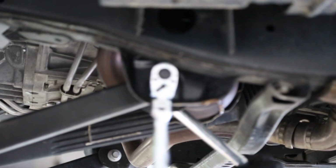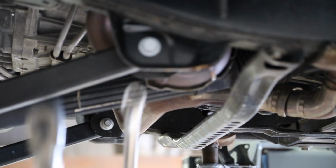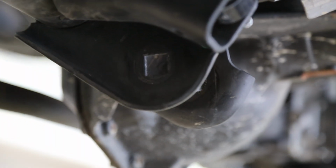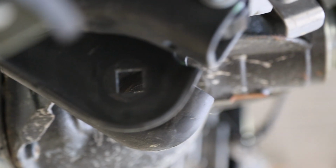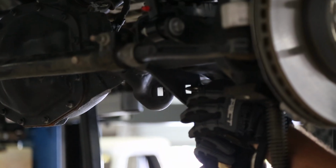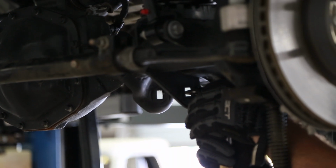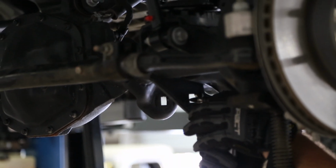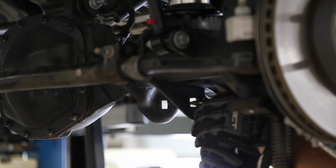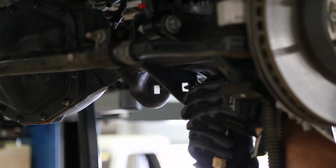For the caster correcting cam locks installation, I took the Jeep to San Diego Off-Road and Custom in Lakeside, California, as I knew that Mike had a lift, high-speed air power tools, and the right size tools to torque the connecting arms after grinding away the material necessary to make the correction to the caster setting, which had changed when the body and the frame were elevated further above the axle by the lift kit. A member of San Diego Jeep Club's board, Mike is an excellent mechanic and is highly recommended by just about everyone in the club. You can add me to that list now, Mike.